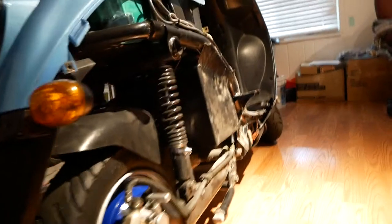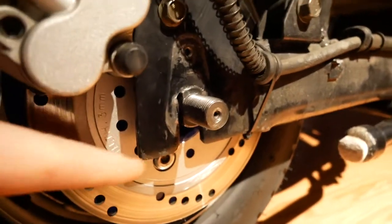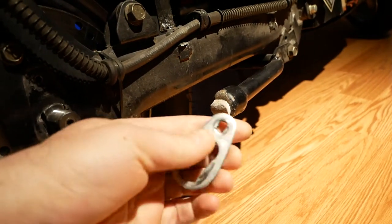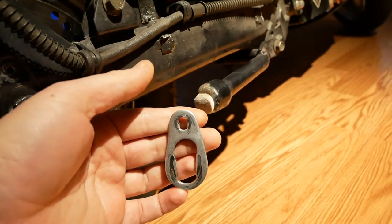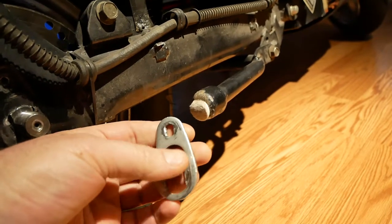I don't know anybody else who's got a 75cc scooter that does 75, and certainly not one that accelerates like this one does — because I've got about 45 horsepower. You can see how the paint's all been skinned off of here. This is the torque arm that was on the flats on the motor axle, and you can see that it's twisted. Torque from the motor under acceleration was slowly twisting this torque arm over.